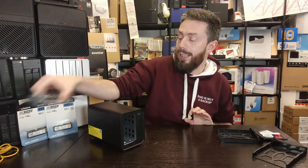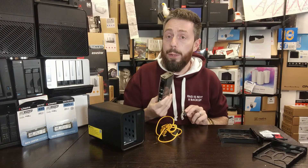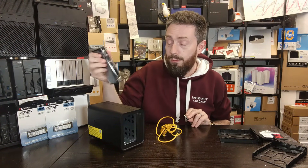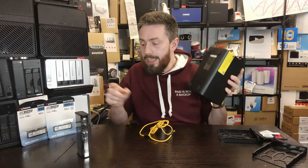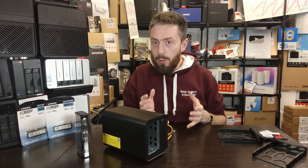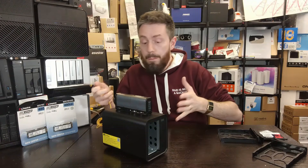The system is quite low-powered with a modest PSU, so you can run it on quite modest power units. Using a Shargeek 140 USB power adapter with a USB-C to barrel jack converter — costing about $4.70 — supplied enough power to run three NVMe drives and two SATA SSDs (not hard drives) for up to six to seven hours, making it a viable high-performance portable solution.